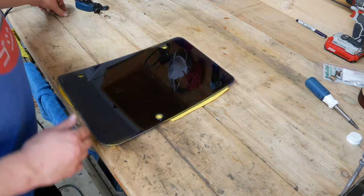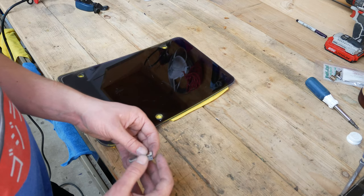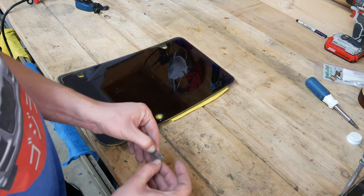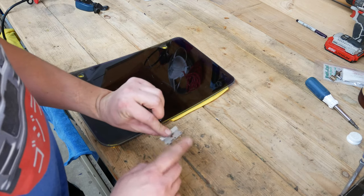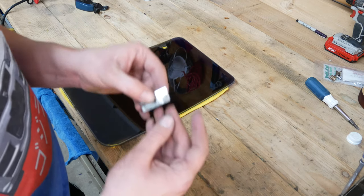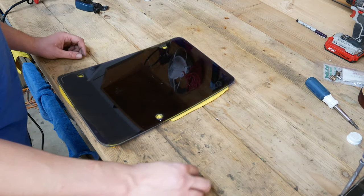The other thing you're going to want is a new razor blade. It's got to have a perfectly sharp edge — anything that's got little grooves in it or is damaged can scratch your glass. You need to have a perfectly smooth razor blade or you can actually hurt your glass. This one looks old but it just has some weird surface rust from the package; the edge is perfectly smooth and flat. If you notice you've damaged it, go get a different one. They come in packs of 20 — I'll leave a link below.